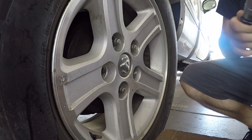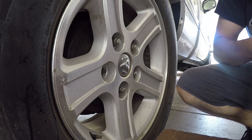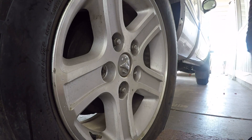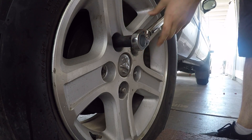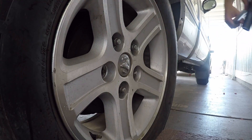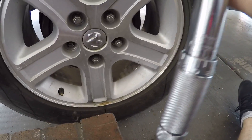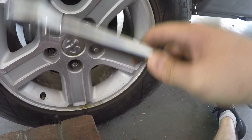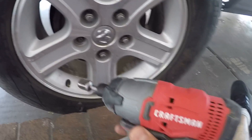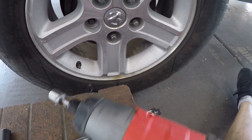I'm going to go up to 140 — let's see if the impact got us to 140, that would be crazy. I think the impact is rated up to 135 foot-pounds based on the box. This torque wrench maxes out at 150 foot-pounds, so I won't go higher than 140 to avoid stripping the lug nut. But tightening with the impact went all the way above 140 foot-pounds, which is really impressive.